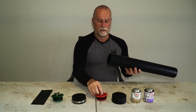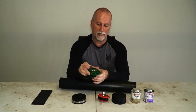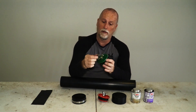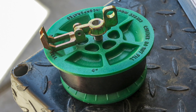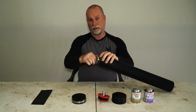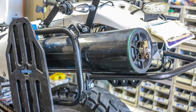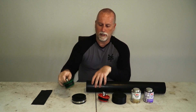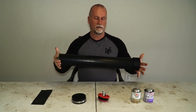If that's not enough security, you can get one of these — it's exactly the same as the drain plug, but the top has a clamp and a lock system on it. You tighten it up exactly the same way, fit it into your tube, and once it's secure, you put a padlock on it. Now you can't twist it at all because the lock tab needs to be clear for the plug to turn. Keep in mind though, if it's on the back of the bike with a padlock, it's metal on metal, so you'll get a little rattle — though you probably won't notice it with a helmet on.